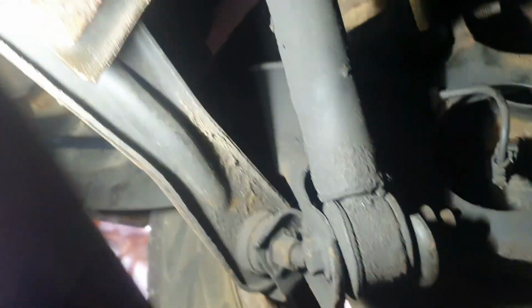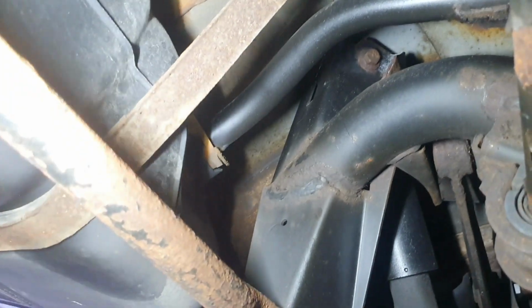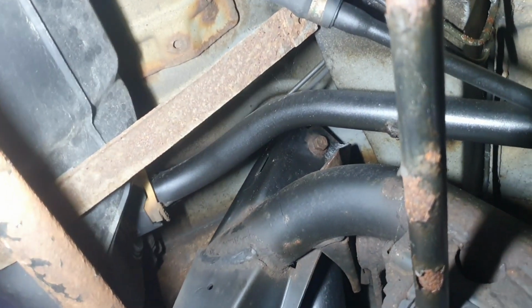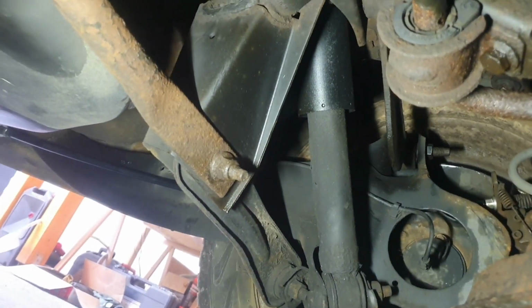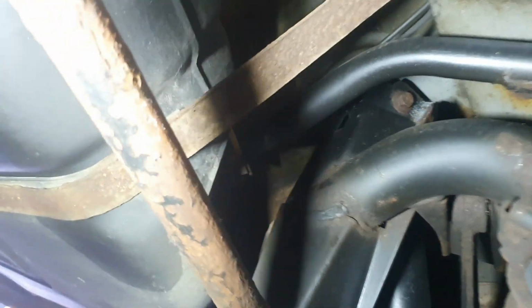We have to replace this shock, or both shocks in the back, but we can see one bolt up in there, and the other one is somewhere on this side. And here is the tricky part. I can't really see that right in there, and I'm not really sure if this is a subframe removal job or not, but if that's the case, I'm going to wait for Daniel, because I won't do such heavy lifting. But I'm going to attempt to use a ratchet in there, and if it's going to work, we have to lift the car for sure on this side to relax the shock, and if it's working, job done, I might say, because this part is very easy. That's the tricky one. I'm going to try, and I'm going to update you on what I've done.